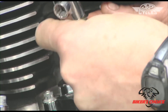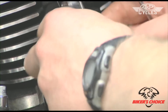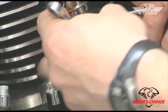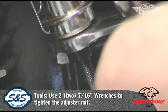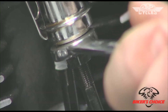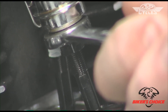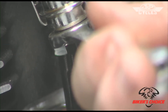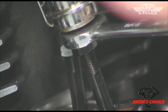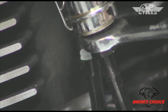Knowing that I'm at the right adjustment, I grab another 7/16ths and tighten that adjuster nut. One thing you'll notice right away is that by adjusting after we got to zero lash, we've compressed the valve spring and opened the valve — right now the valve is open basically 100 thousandths, because that's what we lengthened the push rod by. Slowly over the next few minutes, this lifter is going to squeeze the oil out of it, that piston is going to go down to the center of adjustment, and this push rod is going to start to spin freely.